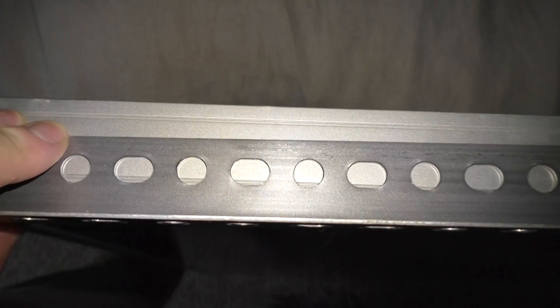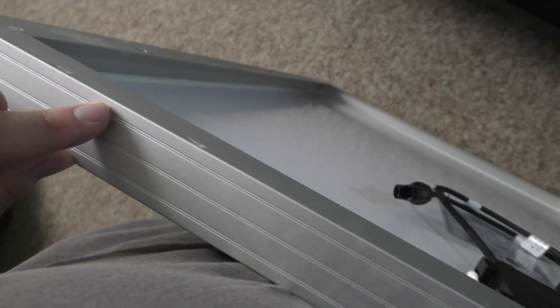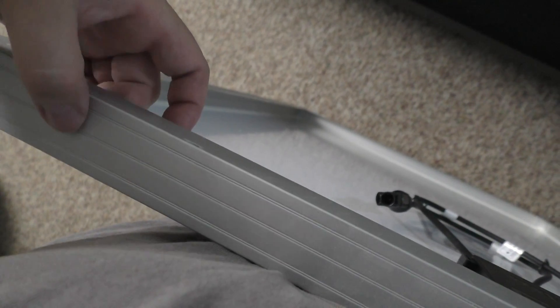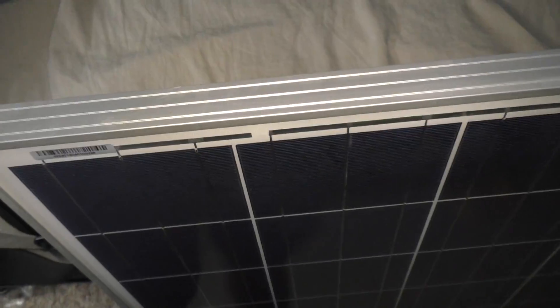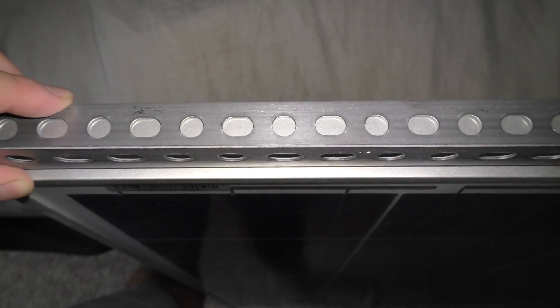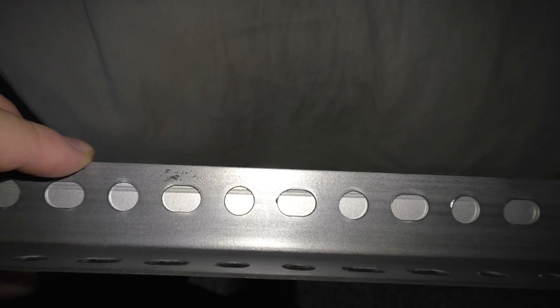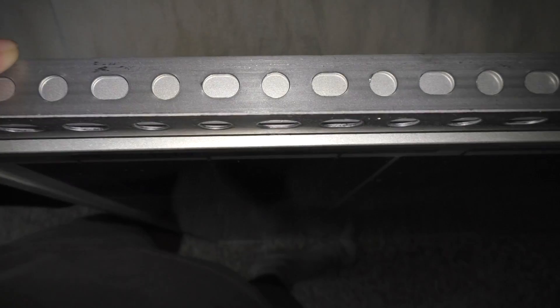If you guys take a look, I'm going to remove that for a second. There's three lines here. Now, under here is a 90 degree bend — I'll flip this over and show you. You got your 90 degree bend. The first line I can't really do much with, bolt-wise. But the second one is actually perfect. If I put my finger back here, in between that one and that one will be perfect for bolting, because I have enough distance away from the inner panel, which you don't even want to touch. So when I put the angle iron on, there's the very first line, and if I line it up so you guys can see, I'm in between both lines right there. Now I have drill holes, drill markings, and that'll be just fine.